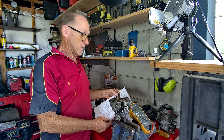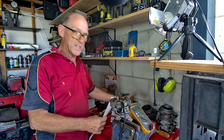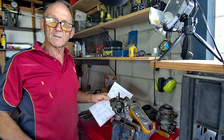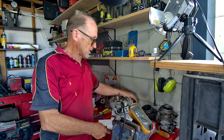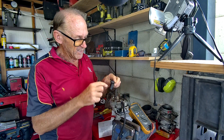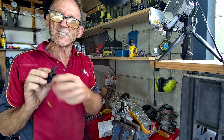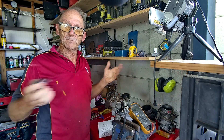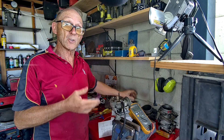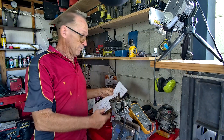If there is spark at the coil, you've got a problem with your rotor, cap, or HT leads going into your spark plugs - check all those out. The most common thing with a rotor is cracking down the side, where the spark hits the terminal and earths straight out onto the shaft. With electronic ignition that could also damage your module and your coil.